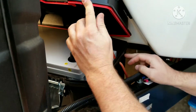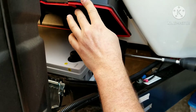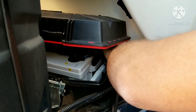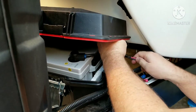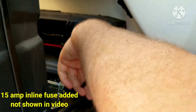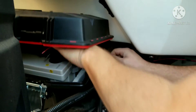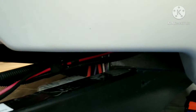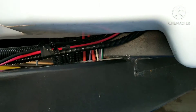Here I'm going to be drilling into my battery box, which is another DIY project I did — I can leave a link for that in the description. Basically just running another hole to run my wires into with a grommet. After I drill this hole, I'll get the little rubber grommet in there. Get those wires in there and twist that rubber grommet into place. It does take a little bit of manipulating sometimes to get those rubber grommets in. The wire loom is on it — takes some tape to clean it up onto the other wires. Basically that's it for the outside, so we'll finish hooking that up in a little bit.